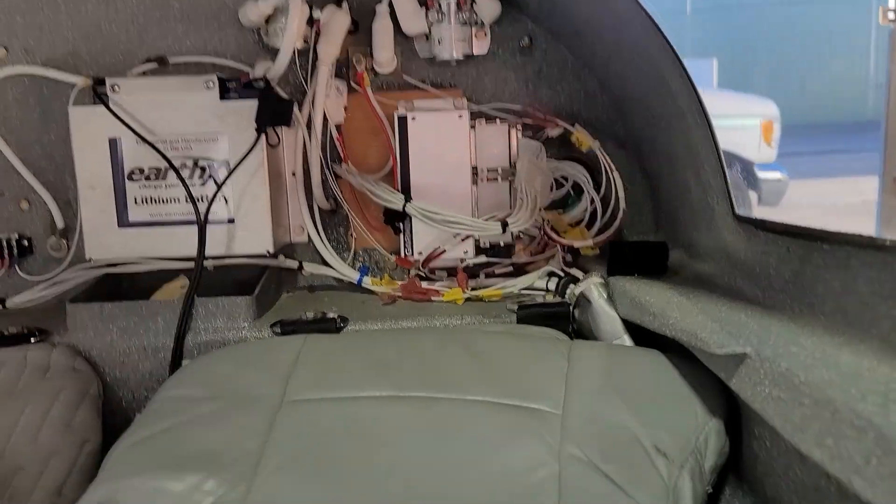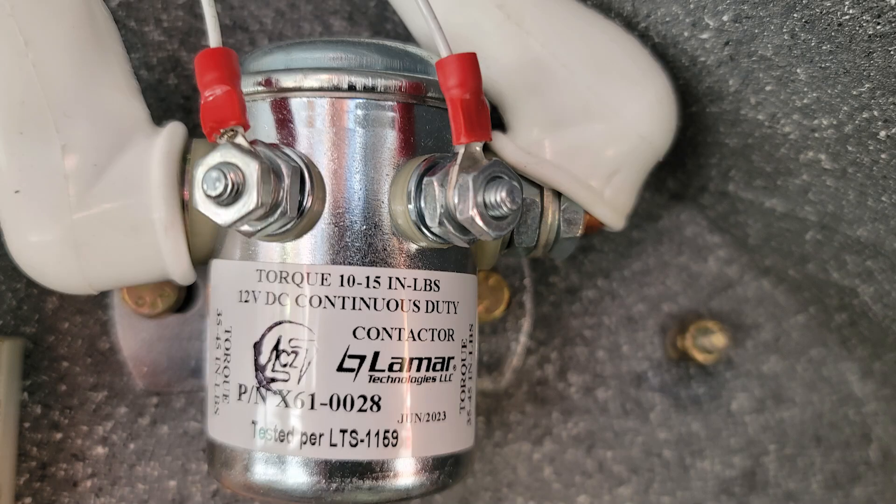I still do have to have a look at that contactor — that's no good. I've reached out to Lamar, the manufacturer of this contactor, to ask if this type of voltage drop is typical for this contactor, because it's not mentioned in their spec sheets. The camera didn't record the next test, unfortunately. But I pulled the connector apart on the EIS, and sure enough the bus voltage powering the EIS — which is the voltage it actually reads to determine bus voltage — is that low 13.0 to 13.1 volts. I was right. The voltage drop is coming from the fact that it goes all the way up to the front through the breakers and switches, then all the way to the back again powering the EIS. It's more than enough power to run the EIS, but it's not a good representation of what the true bus voltage is.